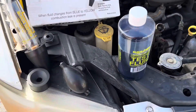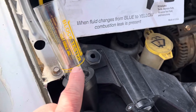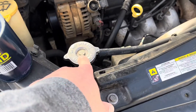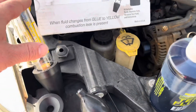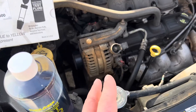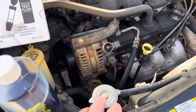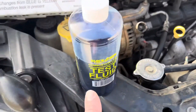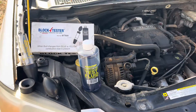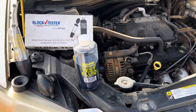Really simple to set up. What you'll do is first fill it up to this level with the fluid. Then we're going to take the radiator cap off with the top on there. We'll run it right through and pull some air through that fluid with it running — preferably with the engine running. That way we'll catch any combustion gas, and if this turns yellow, we'll know that you've got a blown head gasket.